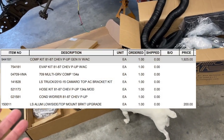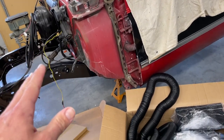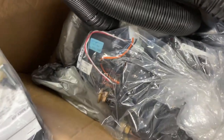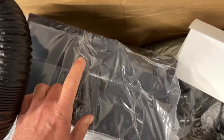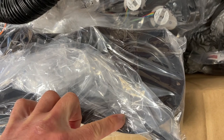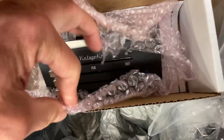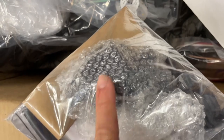Put an image on screen of the part number we ordered — essentially it's for this truck, an '86 model that came with factory AC. These are evaporator mounting brackets. This is the replacement for the glove compartment because it has to shrink considerably. Here's some plastic ductwork backing they send you, as well as a back block-off plate that goes in the passenger side kick panel. Here's the control panel — it's nice, it has chromed buttons.